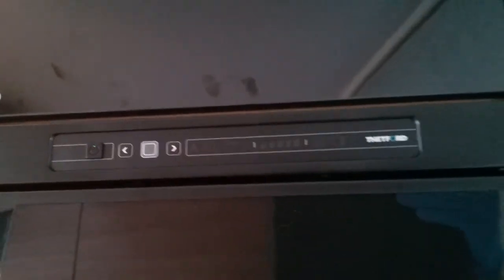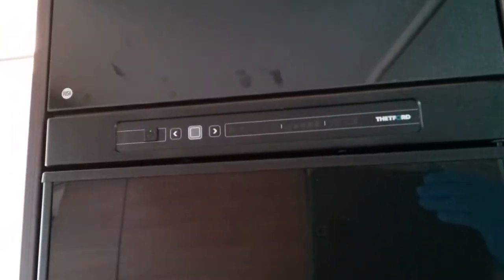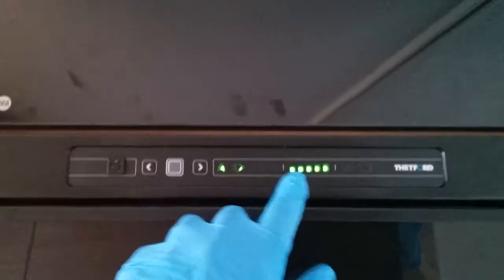If I now went outside and unplugged this from the mains supply, it would then attempt to fire itself up onto gas. And as soon as we hitch up to the tow vehicle and start the engine, it will then automatically go over to 12 volt maintain. We can take it out of auto if we want to.